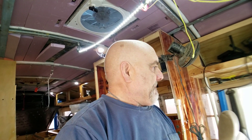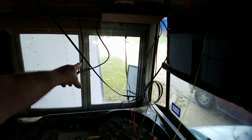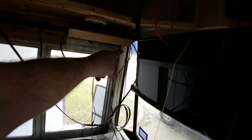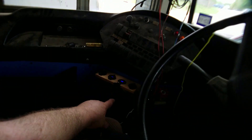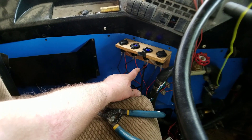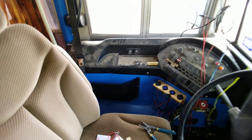Just wanted to bring you up to speed on what I've been working on. Right now I'm adjusting the parking brake — when I'm on a hill the parking brake is not grabbing very well so I need to adjust it. I also ran my wires out over there and then in here behind the dash, the side dash, and drilled a hole and put a rubber grommet in there so it doesn't scrape through and cut through the insulation.